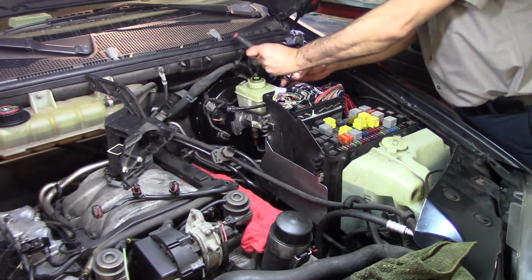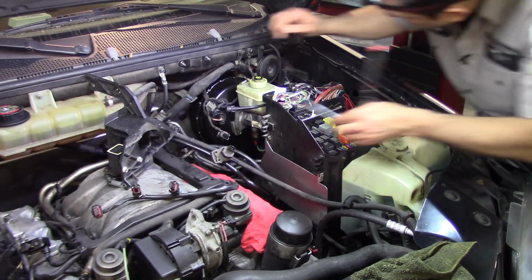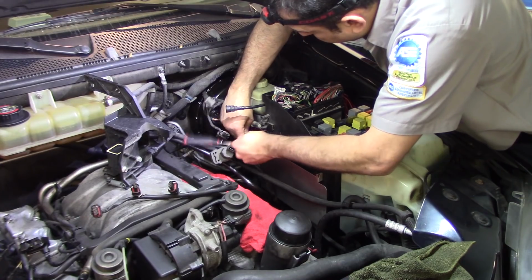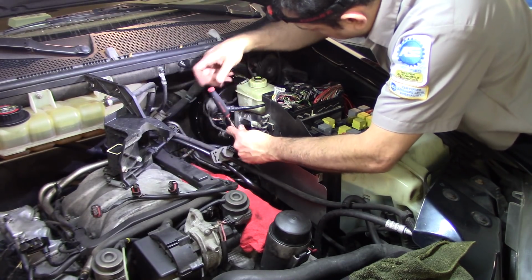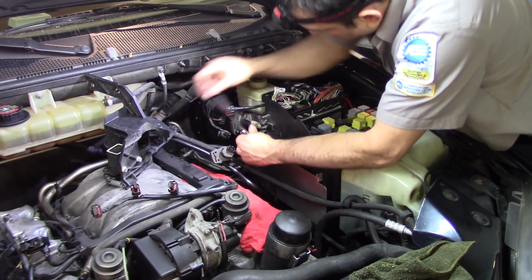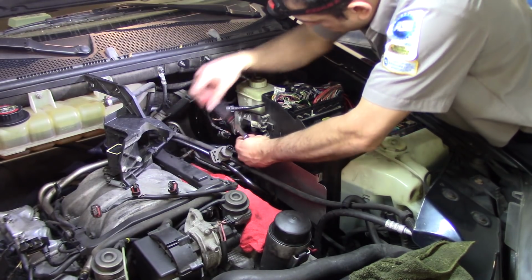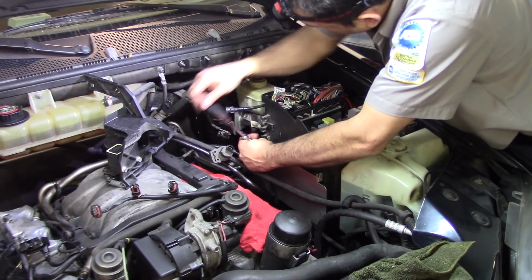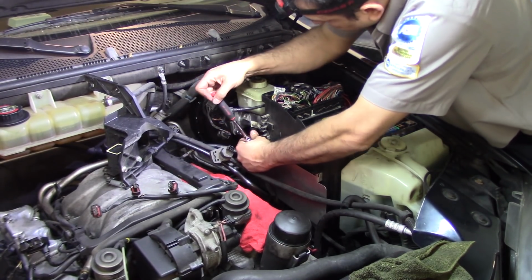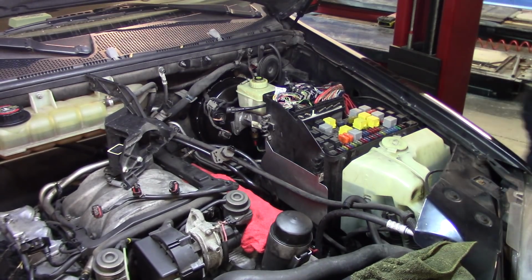We know that thread is new. It might have a little bit of paint, but it's new. Alright, so that one is tight. And we can tie this one now too. And yes, I'm going to put the torque wrench on here too. I just cannot show that every single time. But you guys that know me know that I use Sentry for all the repair information. I like to do it like that, especially for things that aren't going to be there for a long time. You don't want them to come loose. So, yes, snug.